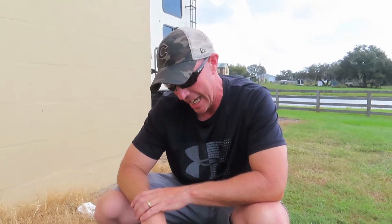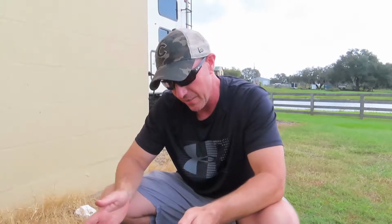The sport fish yachts put quite a bit of abuse on the batteries, and we would typically see between 2 to 3 years out of a set of commercial Group 31s on the house battery side on those big yachts. So it's a good option. You could always go with, if you have smaller batteries, then you would want to go with a deep cycle Group 27, a deep cycle Group 24.